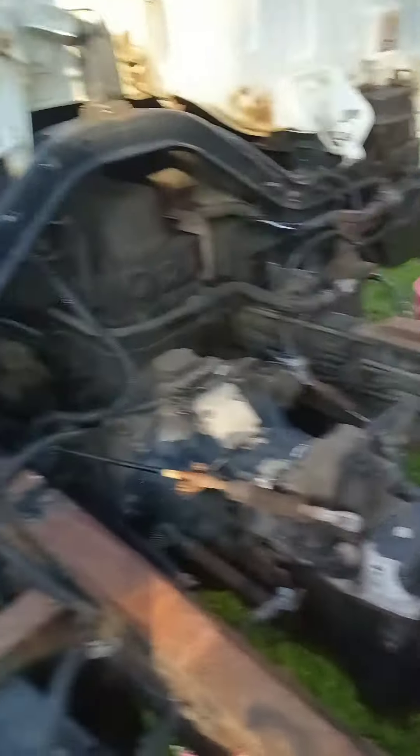I'm about to check the rear axle too, and it's pretty much the same. There should be an upper fill plug on this. This is a breather, I believe. There's a high and a low plug on that. I'm going to pull that out and stick my pinky in there and make sure it's up to level and good.